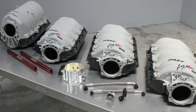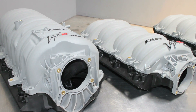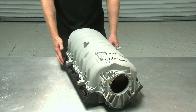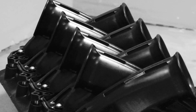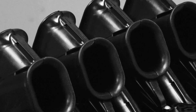For truck applications, or cars where the hood clearance isn't a problem, there is the LSXRT manifold. It will fit on any 1997 or later LS cathedral port truck engine, and it will also work with any LS1, LS2, or LS6 application where you have the additional headroom necessary. The extra interior volume is worth as much as 25 additional horsepower on a stock 6-litre engine when used with FAST's 102-millimeter throttle body.